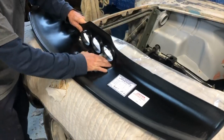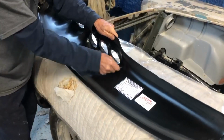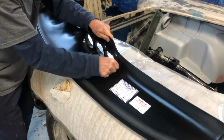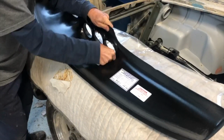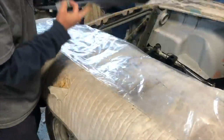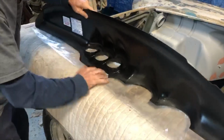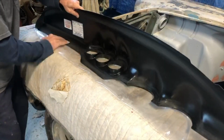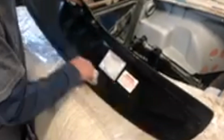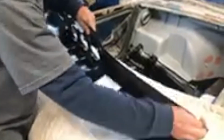And the perimeter is just where we're going to be installing the adhesive. There's really no need to sand where we aren't going to be installing adhesive. So you can see Greg kind of has a perimeter around the back of the dash cap and sort of around the gauges, and just only sand that perimeter. And of course, you want to make sure that you clean down your sanded area with some cleaning solvent again.